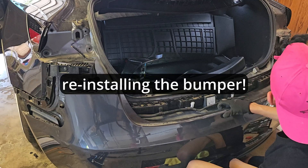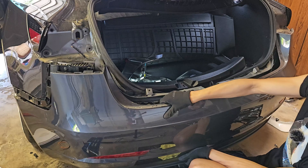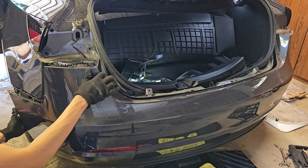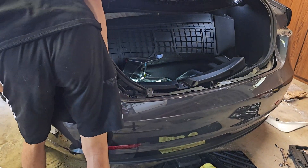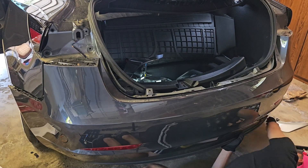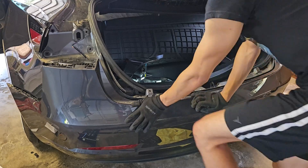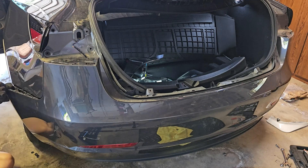You can see the tow hitch sitting nicely under there. Super carefully try to put the bumper on to the top part so it can rest there. Be careful not to scratch your paint as you're pulling this up. When you're putting the bumper on, it's super important that you don't make this mistake — no other videos talk about it. When you put that lower skid plate — remember it's still attached to the bumper, the long black part on the bottom — you want to put that over where you took it out from. Make sure that's aligned. That is so important before you start putting the tail lights and bumper everything back together. Make sure that bottom skid plate is aligned — cannot stress that enough.